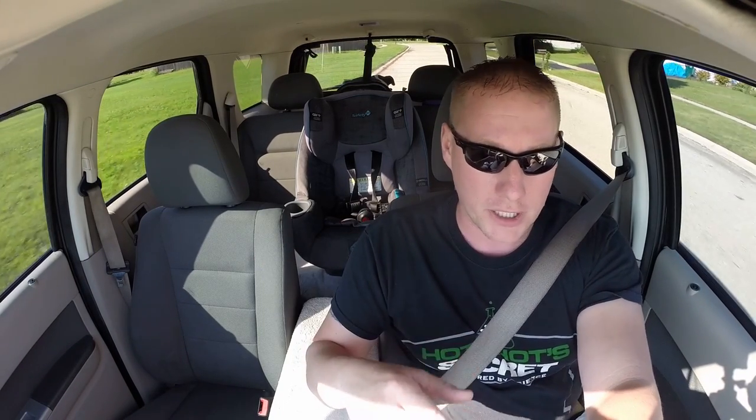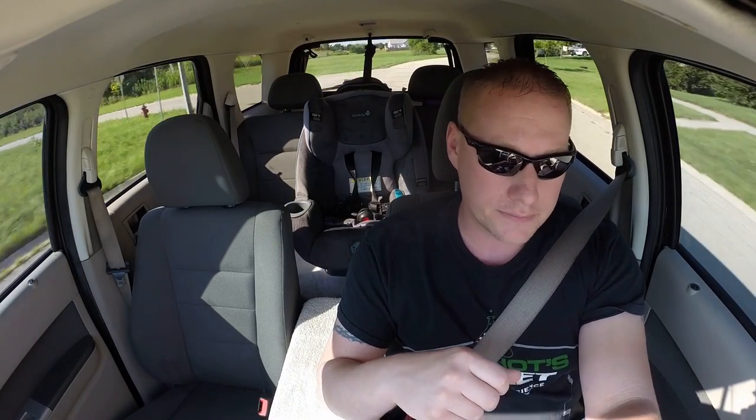We're going to start the burnishing or breaking-in process. Until we get to a nice open area, you're just going to want to drive with light pressure on the brakes whenever you go to stop signs. Now is a good time while you're going slow to listen for your brakes — you don't want any unusual noises or squeaks happening. At lower speeds we're safer, so let's listen for the brakes as we head down the street to the open area.